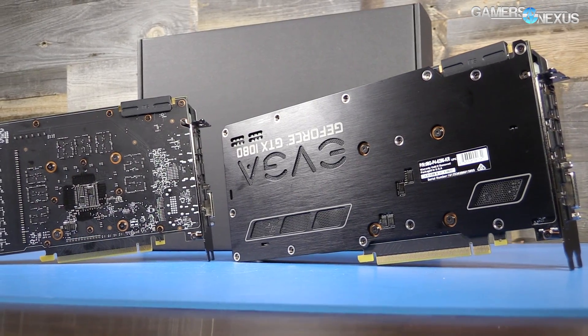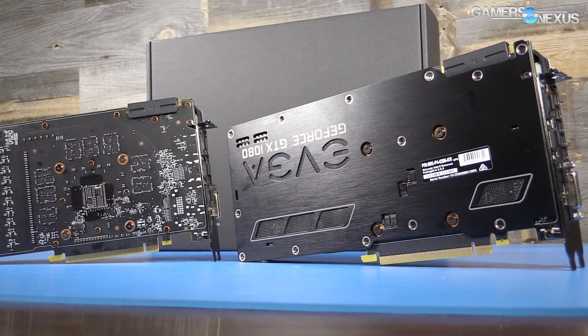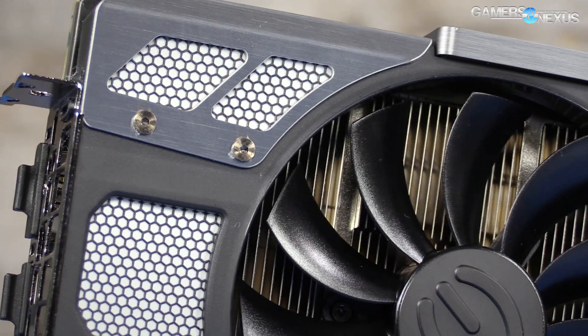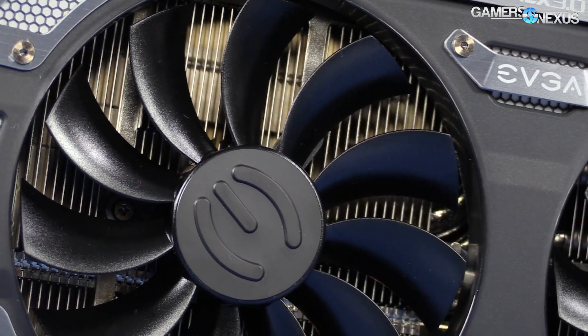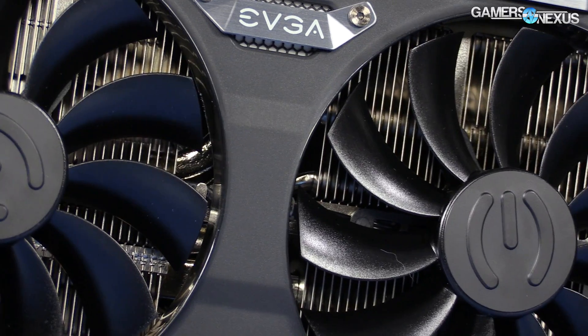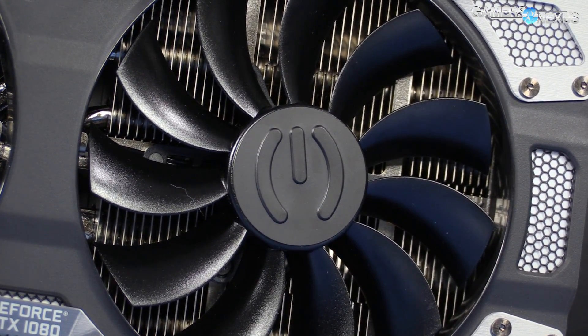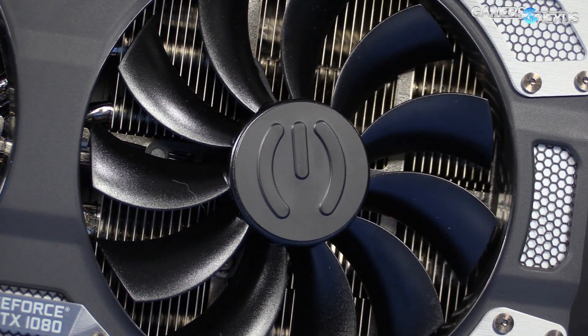Especially since the backplate was effectively acting as a hotbox before applying thermal pads — the backplate and base plate were mostly just trapping heat with no interface to transfer the buildup from the power stages or FETs to the heatsink. Buildzoid will be joining us in a few days to discuss this in greater depth. We're currently running endurance tests on the 1080 FTW with and without thermal pads in both torture and real-world scenarios, including poor airflow cases. EVGA's solution has been to supply free thermal pads for users to apply themselves or swap with EVGA.